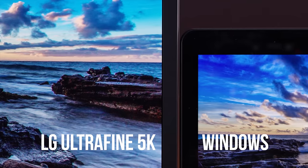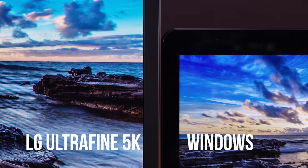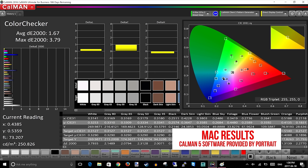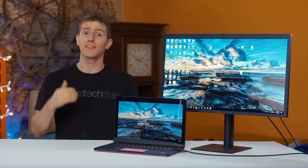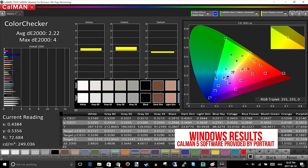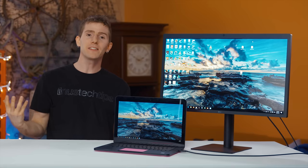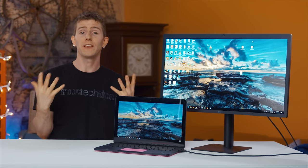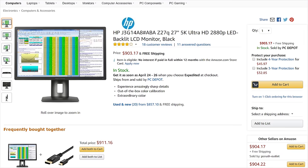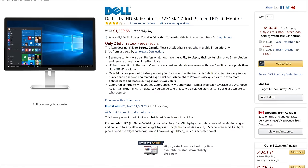And it's not just resolution difference and lack of control that are iffy. Because Windows relies on applications to do all color matching rather than doing it pixel by pixel on the OS level like the Mac, PC users will never get to experience the consistently awesome color accuracy enabled by this factory-calibrated display. To be clear, it's still a very good 8-bit IPS panel with AFRC to simulate 10-bit color, and it's got 99% coverage of the DCI-P3 color space, so even on a Windows machine it'll be suitable for photo editing and graphics work. But at $1,700, you'd be paying a premium for oomph that you aren't receiving — especially when both Dell and HP have 27-inch 5K offerings with somewhat similar specs at lower price points.